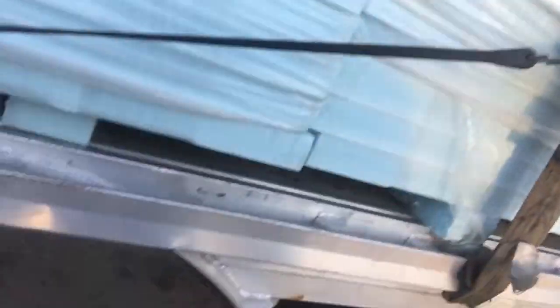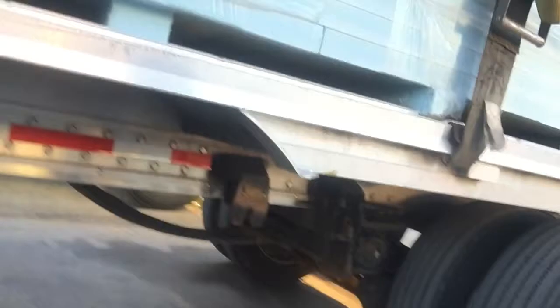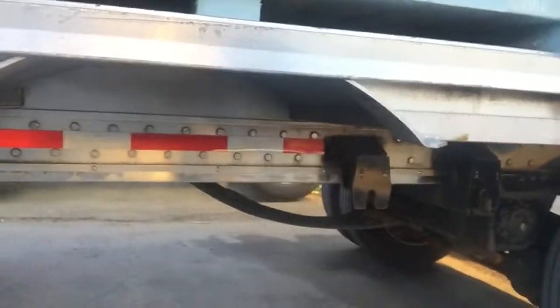The reason why I had to use it — if you look on this trailer, this can go from spread axle, and this axle right here will slide to this position to make it a tandem. I had to do that yesterday to get into that little tight place, because tandem axles turn a whole lot better and follow the truck better. Spread axles just do what they want and be all over the place.